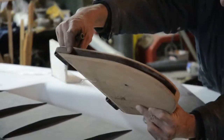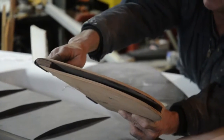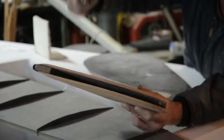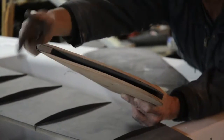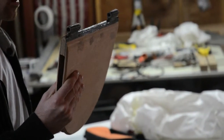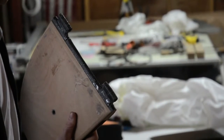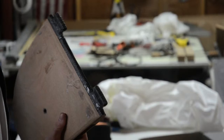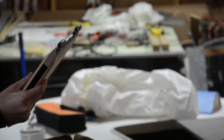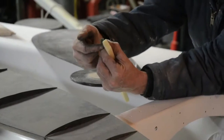that little guy, that insert, which has carbon wrapped over it, up against it and crazy glued it, and then just took a bunch of rope of carbon and started wrapping it around this thing. And it fits on there really tight, but that thing pivots in the same manner as a control arm, but vertically. Right. And was able to control the pivot in a pretty big distance. Yeah. Just using something that sat in there or fill this gap with glue.